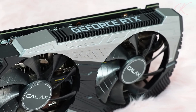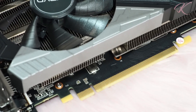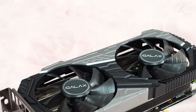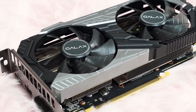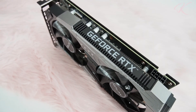For superb performance and viable 1440p gaming, it has been fitted with 8GB GDDR6 memory with a base clock of 1470MHz and a boost clock of 1650MHz. The memory interface width has been increased from 192-bit to 256-bit GDDR6, providing a memory bandwidth of 448GB per second.